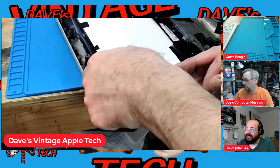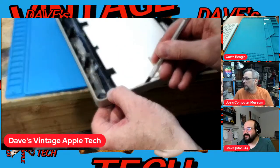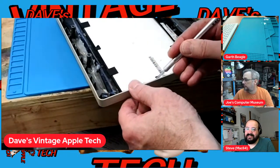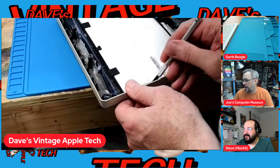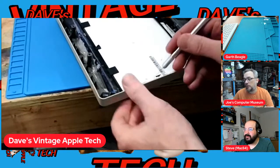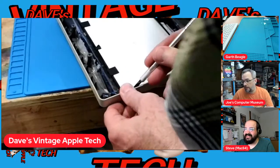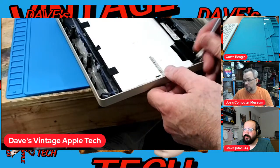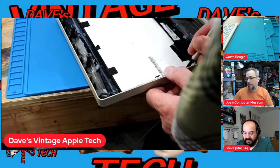So yeah. I plugged it in and no smoke happened. Good. Well, that's great. If you follow step 2, it says to make sure you have homebrew installed. I got that because I'm a smart man. Okay. And then you double click flash-mac.command to follow the instructions. The option that'll come up is probably option 2, which is to flash a blank one or update an old one. Dialing 1-800 Blue Scuzzy. Connected. Okay, so upgrade via USB or prepare blank. 2, prepare blank, because yours doesn't have the USB firmware yet. Okay.